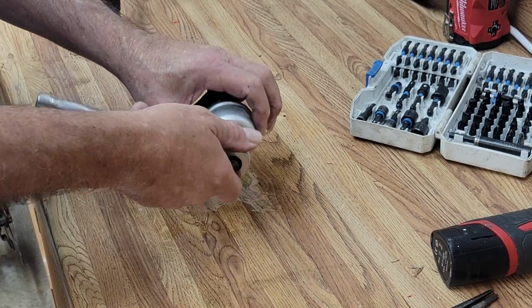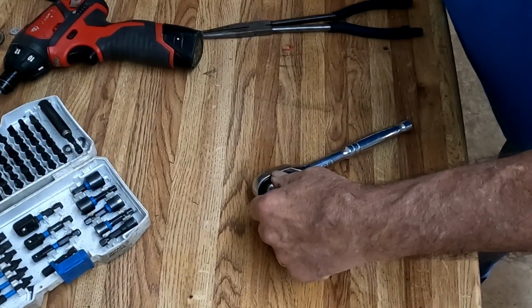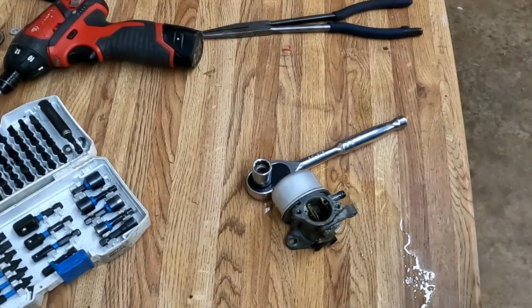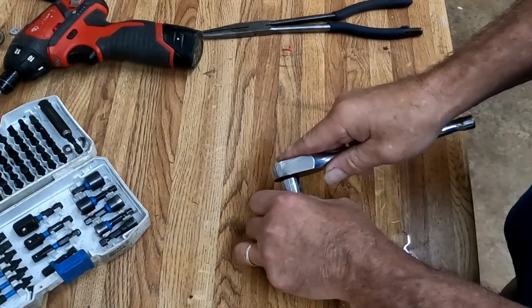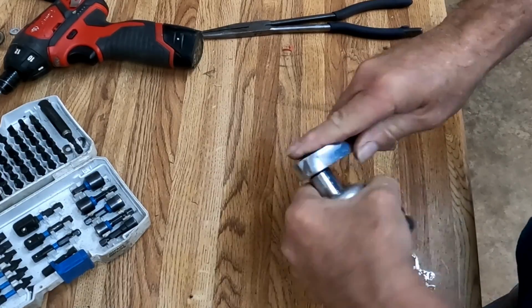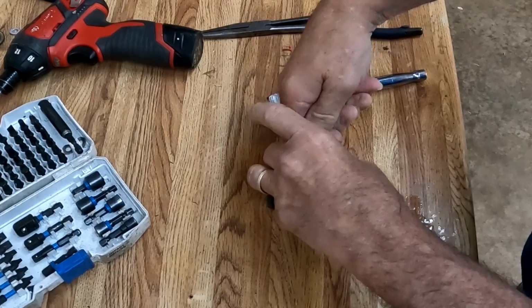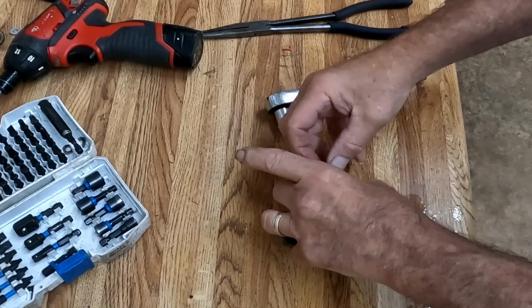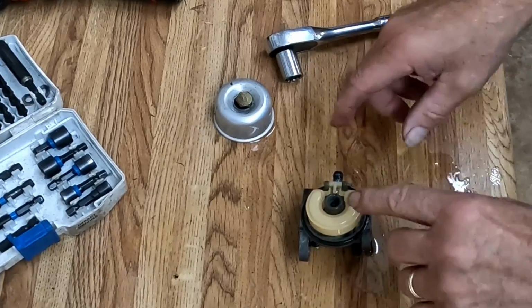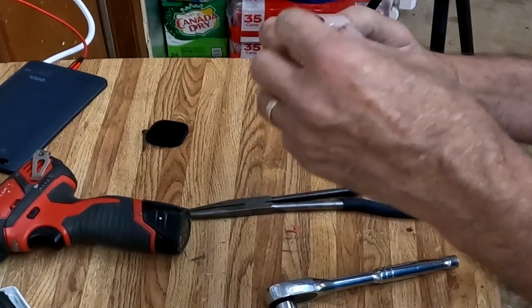Okay, this won't take long at all. First thing we'll do is start warming up the cleaner. And we're using, in the ultrasonic cleaner, Pine-Sol and water. You can thank the lawnmower lady for that, because she knows the combination that won't turn the carburetor funny colors. But it's a safe bet that this right here is the problem.